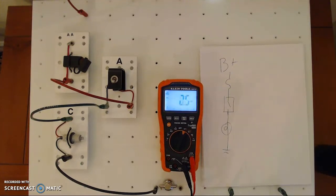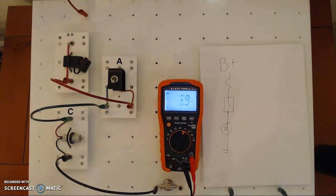Let's talk about the three elements of Ohm's Law. Voltage is analogous to pressure — think water. Voltage is like pressure from a water source, like a hose at your house. That water pressure allows us to do work. Voltage in an electrical circuit is very similar; we measured it at 12.09 volts — that's the pressure pushing those electrons. Right now we have no electron flow. The actual flowing of electrons is current, measured in amperage. Anything that opposes that flow is resistance, measured in ohms.